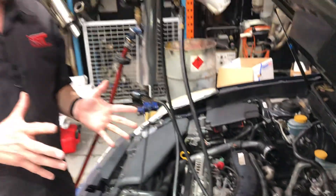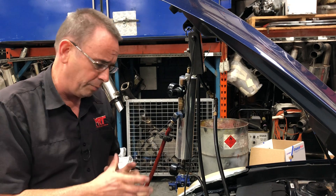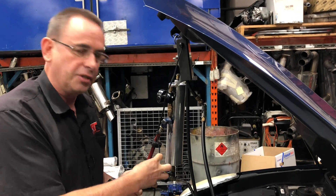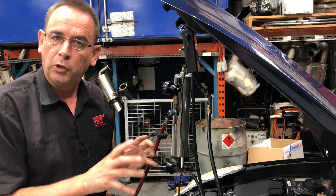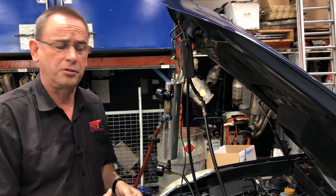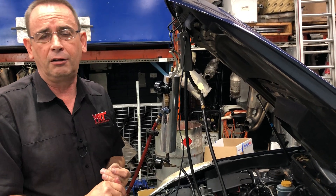The good news is on this particular car we have saved the customer the replacement cost of his turbo, and at the same time we've improved the health of the diesel particulate filter because it had a high soot buildup. The chemicals running through the engine have a cleaning effect inside the engine, and as they progress through they clean all the rest of the parts out. Once it's all finished we change the oil as part of the process, do more road testing, then a forced regen of the DPF to make sure it's as clean as possible, and finally a critical test on the turbo to make sure the vanes and boost control are working within spec.